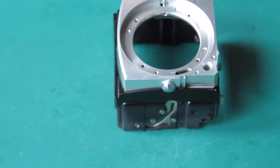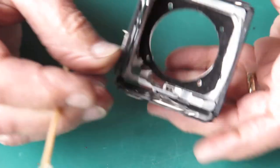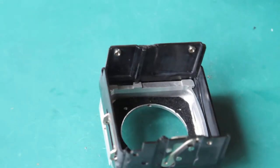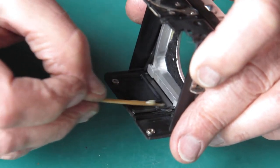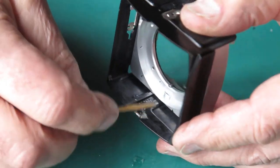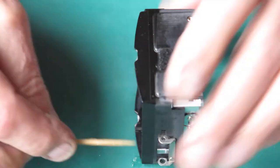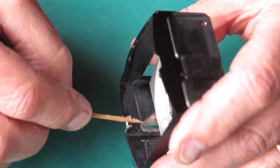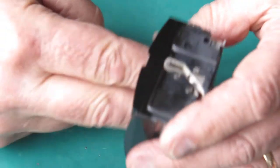That's working nicely, so I will lubricate that front section. Basically it runs on these rails here, top and bottom. I need to lubricate those with a bit of synthetic grease. And in the center here is where the chrome button runs. That feels a bit rough at that side. That was at the bottom — that really wasn't the area that appeared to be causing problems, but that's certainly felt a bit rough at that point.